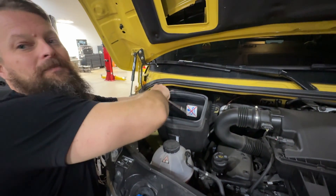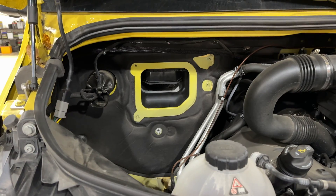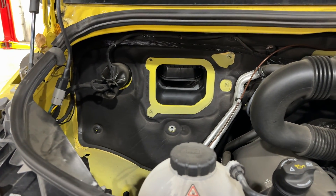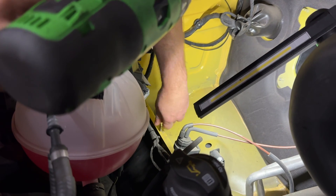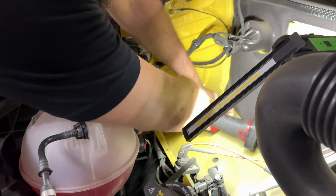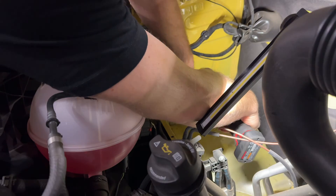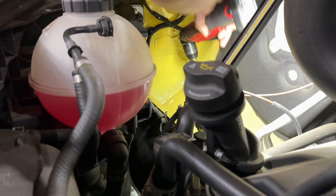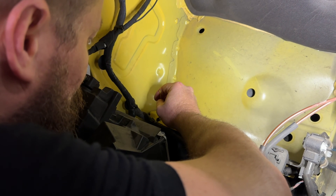Pat is removing the cabin air intake, which does go up to the hood - it's kind of a convoluted thing. There's where it was; you can see all the free space in the engine bay. Then we start to tap and make holes for the hardware that comes with this mounting plate. This is not that much different than normal ARB compressor setups; the thing that makes this particular one different is that it comes with that pressure control module, which adds a layer of complexity to the setup.